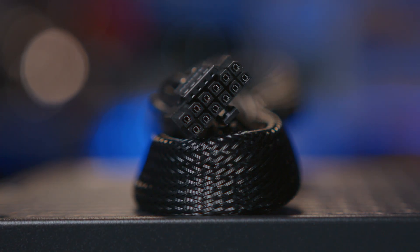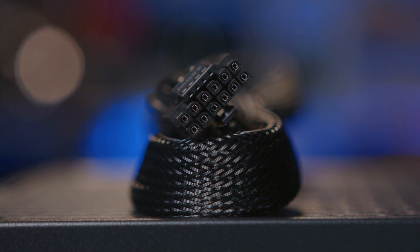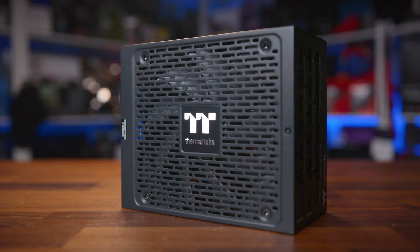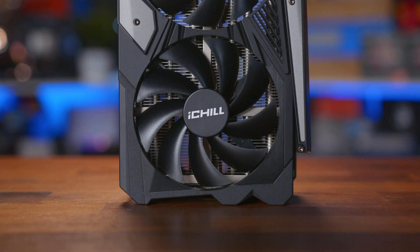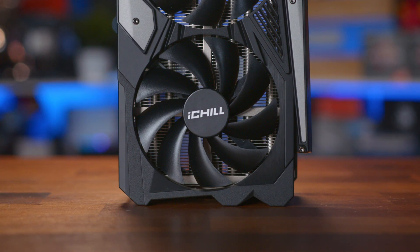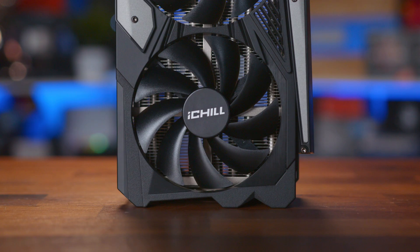Within this cable, the 16 pins aren't all the same, as four of them are sense pins, including ground, depending on the wattage limit. That actually allows the GPU and the PSU to talk to each other so that the GPU knows how much power can be delivered at any one time. This isn't anything new, as a typical PCI Express eight-pin connector, like we've been using for many years, has exactly the same technology — now just implemented onto the new connector in a slightly different orientation. This allows the GPU to throttle its power limit based on the capabilities of the power supply so that it doesn't end up spiking above that limit, shutting your system off or leading to general instability issues.